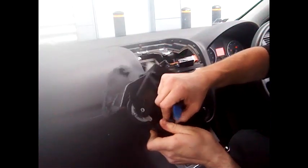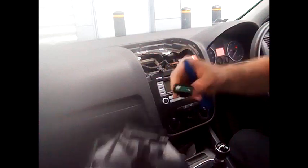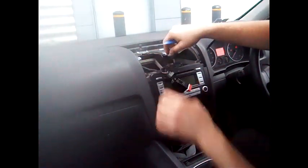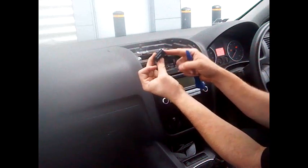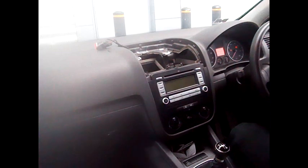Now because you have disconnected it, the system will think it is faulty. So remove it from here and plug it back into the passenger airbag switch. Once that is connected, you can then test the new radio by turning the ignition on and off. If you disconnect it and turn the ignition on it will throw up a fault code, so make sure those two things are connected when the ignition is turned on.